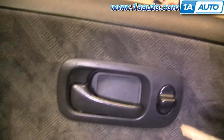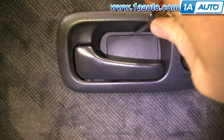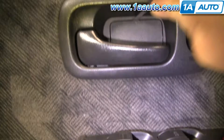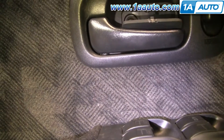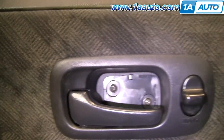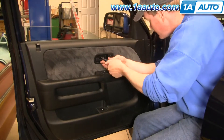To remove one of your interior door handles, use a small screwdriver, go right up here at the center top and kind of work your screwdriver in there and kind of twist and pry out. There's two Philips screws. I'm going to fast forward here a little bit as I just remove those two Philips screws.